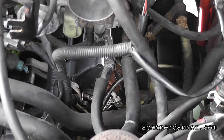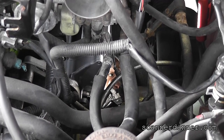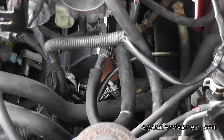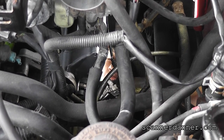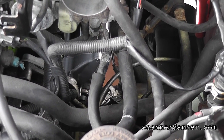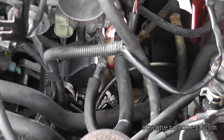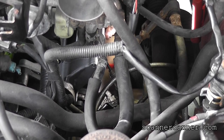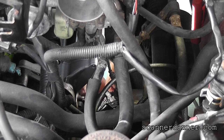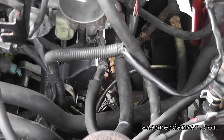Dude, I don't remember. Look at the starter housing. And then there'll be a hole at the very bottom. And that's where it goes. Oh, there it is. I see it. And you might have to have one hand on the starter housing to move it around while you're starting that bolt. Right here? Yeah, possibly. Try putting the bolt in. If it won't go in, you're going to have to move the housing around to line up the hole. It's hard to get my hand in there. Can't even see what I'm doing. You can do it by feel. That's what I'm going to have to do.